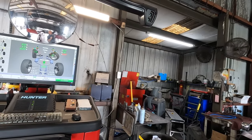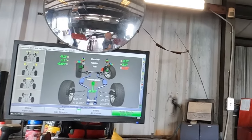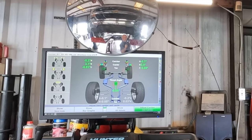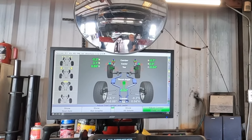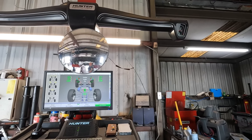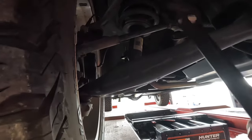I'm giving this about a third of a turn each time. That's how much it changes up there. One more might do it. Now I'm going to go past a little bit and then bring it back in to take out any play in the rack and pinion. Boom — locked that down and we're golden. I had to turn that almost three full turns — it was way off. Looks like someone lifted this thing and never aligned it since.